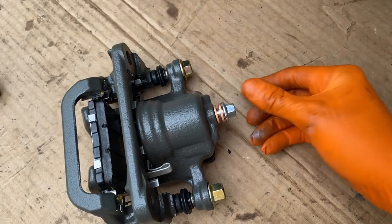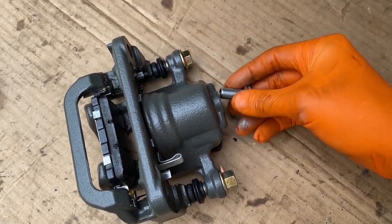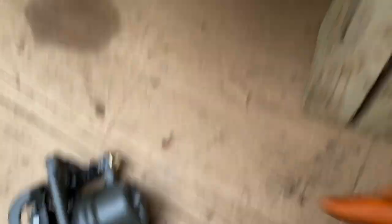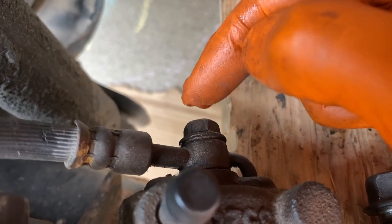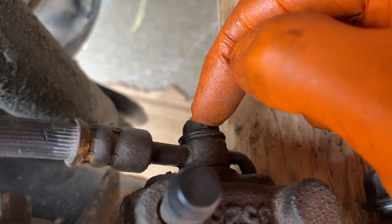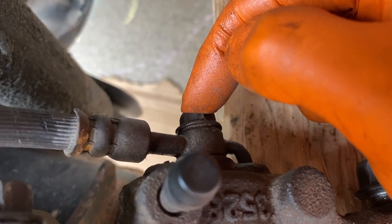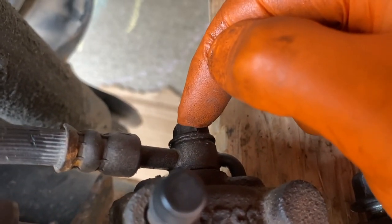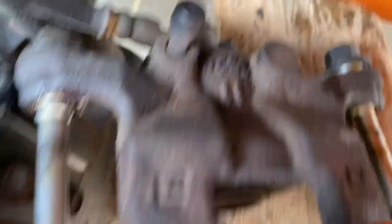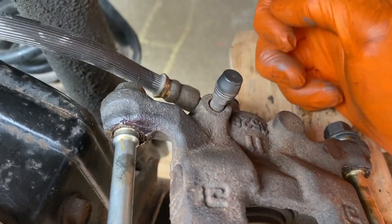Now to the fun part — we've got to do this quick. We are going to remove this long screw with two washers, which connects the rubber brake line. We're going to go very fast: remove this, and this is going to leak brake fluid. You want to do this as fast as you can to avoid losing a lot of brake fluid onto the floor — if you lose a lot you will drain the system and then you have to re-bleed your brakes. So we're going to spin this off, move the old caliper out, put the new one in, tighten it down.